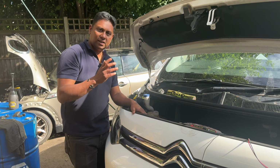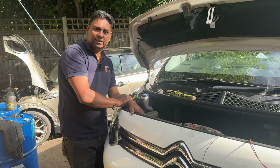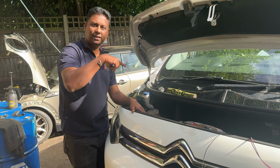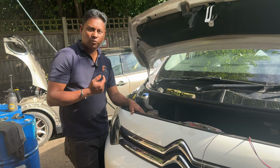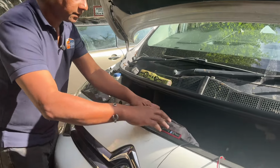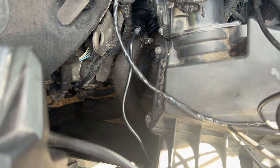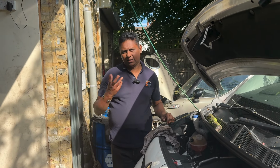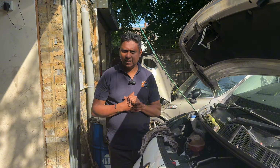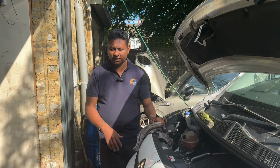Basically, the customer went to the garage and said the heater is not working inside, and sometimes the heating gauge plays up and down. So the garage diagnosed the problem and found the bottom coolant hose, this one you can see, is cold and the top hose is warm, but the vehicle didn't get warm air inside the cabin. So they thought something was not right with the thermostat.